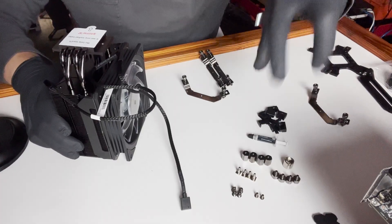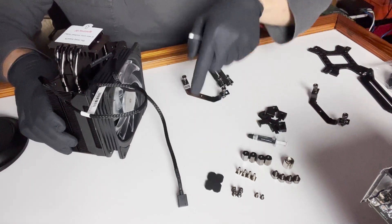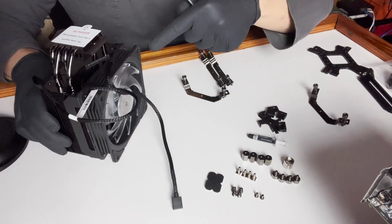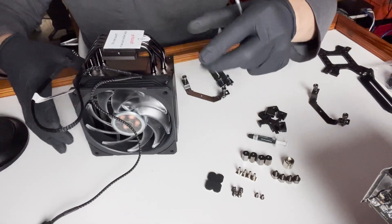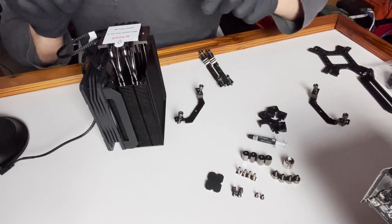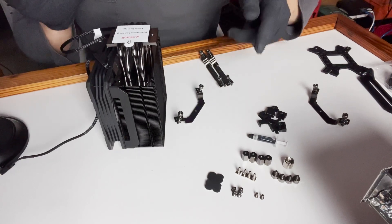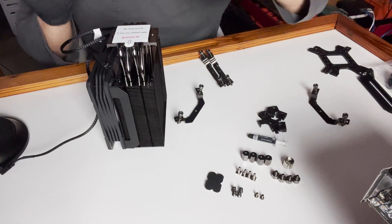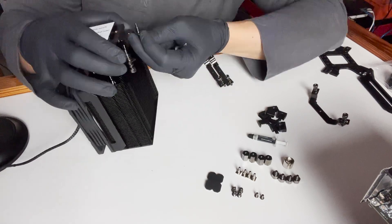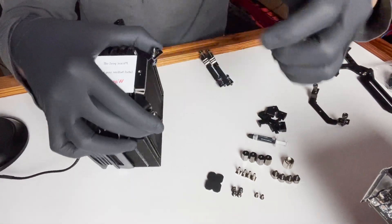Here I've emptied out all the parts — the screws, thermal paste, plastic clips, and these little black rubber bumpers. I'll figure out what those are for as we go. I have the CPU cooler in hand and we're first going to install the bracket. I'm installing this on an AM4 socket for an AMD chipset CPU, though it is universal for AMD and Intel.